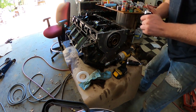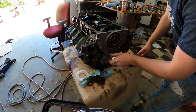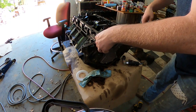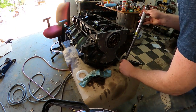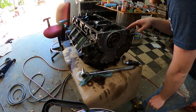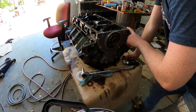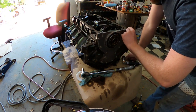And you're going to torque these down to 18 foot-pounds. Also, I'm going to here in a little bit, but you need to put some silicone right here. Horrible design from GM. It'll make your rear main leak from the top of your oil pan, because that's where your oil pan comes together right there. It meets this. So anyways, before you go to put your oil pan on, put some silicone right there. You'll be all right.